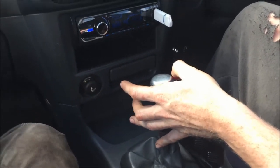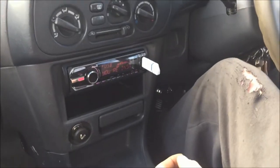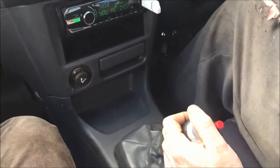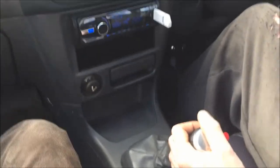The original ECU in this car pulls all the timing out, so basically I'm not using any more than about a third throttle on all the pulls. If we use any more than that it pulls the timing back to around 12 degrees and the engine just makes noise without going anywhere. That's going to be fixed up soon with the Haltech E8 ECU, which I'll be able to tune — add more timing around 20 degrees under full throttle, pull some fuel out for better economy, and still make the same power or a little bit more.